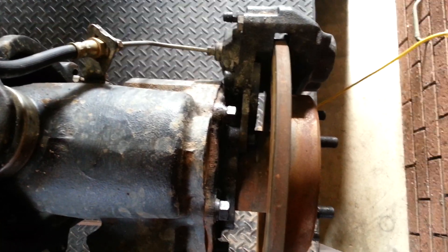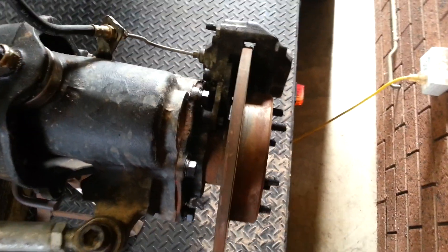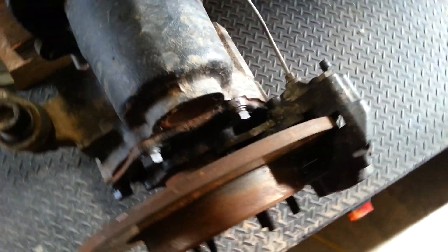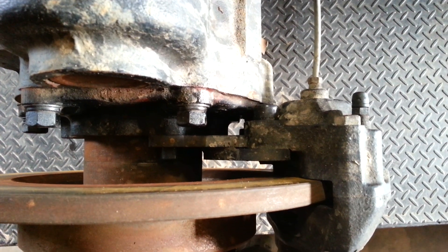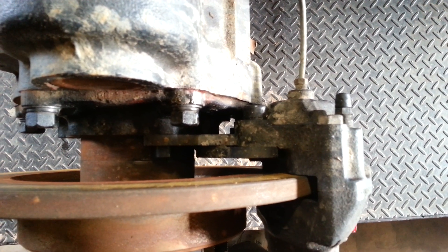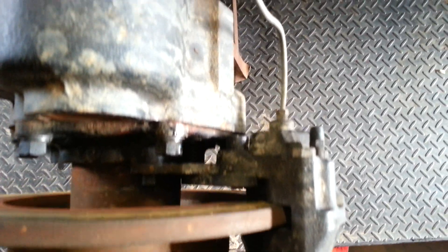As you can see, basically the whole brake drum has been taken off — backing plate and everything. I'm now using the same bolt holes the backing plate bolted into to mount two brackets that are welded together. You can see one bracket bolted to the portal box housing. There's a small spacer about one or two mil thin in between the two plates and they're welded together. Then the caliper is tapped and bolts into that.